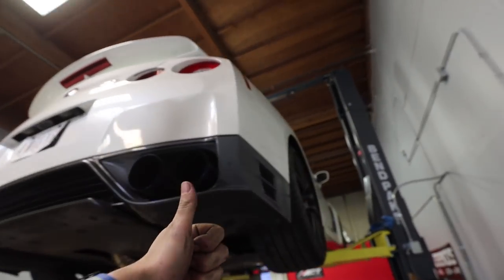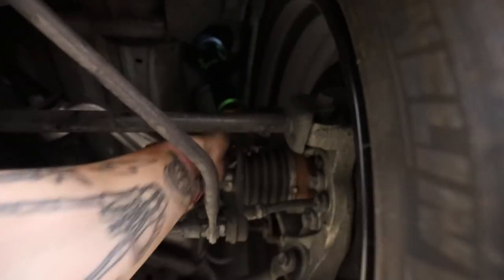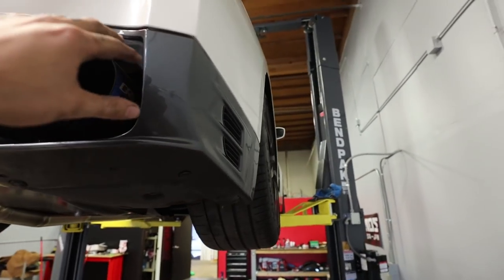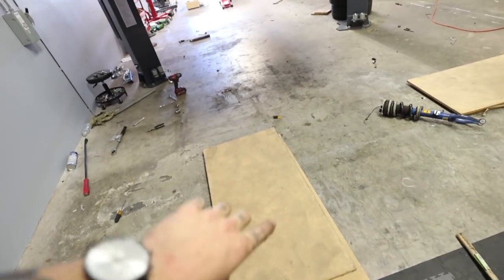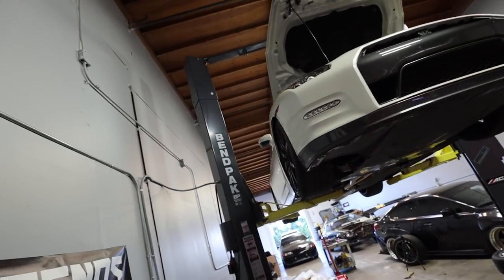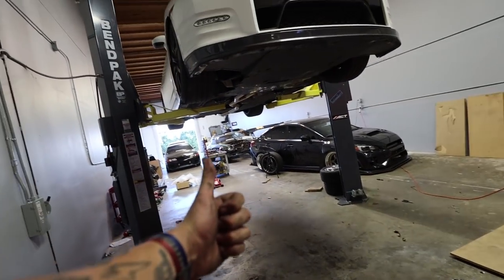All of the wheels are on. I just have the car up in the air so I can inspect and make sure everything is correctly tightened. It's crazy when this car gets lower how much camber it actually adds — definitely in the front and a lot in the rear. But it looks like everything is tight on this car, it's ready to come down. I'll put some blocks because if it's already too low stock, it's going to be way too low now that we actually lowered it. Moment of truth, people.